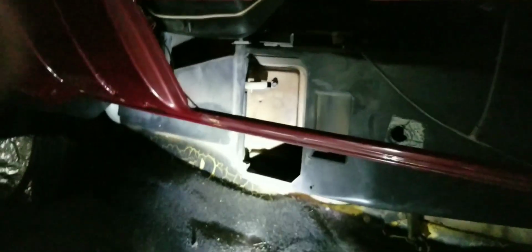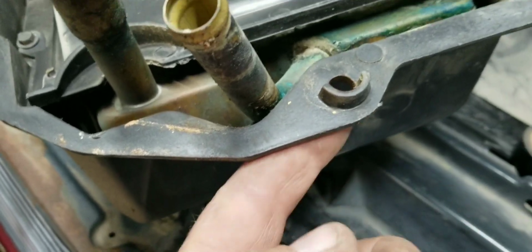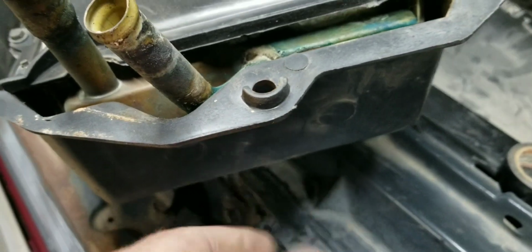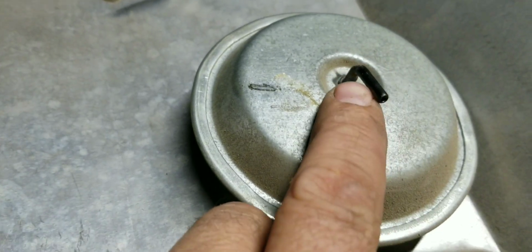Okay, so I will finish getting this box on the inside unbolted because there is some bolts in it. Let's see if I can, it's right there. And there's a couple more around it. And so I will get this unbolted and I'll be back to you momentarily. So there's really only one bolt. After you get all of that out, there's one bolt that's going to be over on the passenger side, far side there. Once you get that one out, this will be completely loose. The other thing you need to do is you need to unhook this vacuum, and then the cable that goes to here.